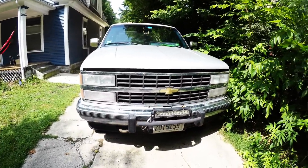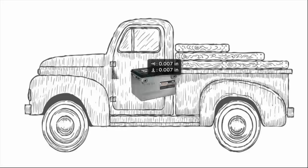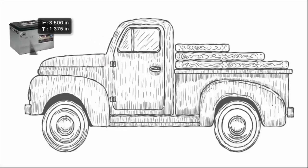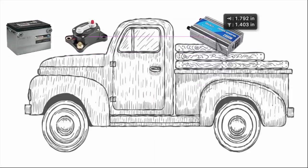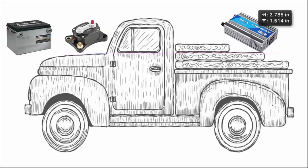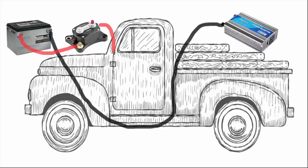Before I get into the project, I'll show you in diagram form all that is entailed. It's not that complicated. You've got the battery up front in the truck, then the switched breaker, and the inverter goes way in back. All you need to do is run your ground under the cab, up and around, connected to the inverter that's grounded to the battery. The hot lead goes to the breaker and out the other side of the breaker, then down around the cab and hooked to the inverter. It's a pretty simple setup.